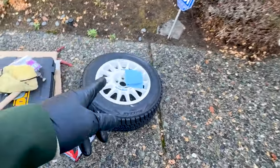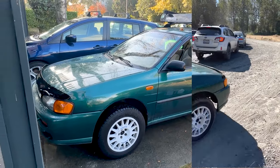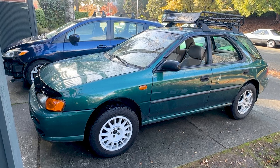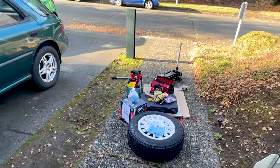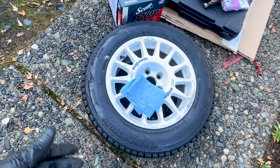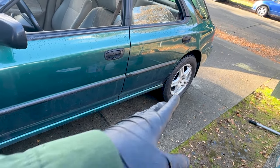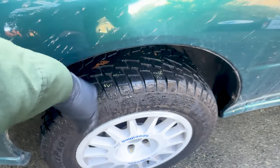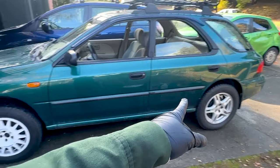The first thing is I went out and got a fresh winter tire. The reason I'm running winter tires is we're going into the colder season, but I primarily use this car for rallycross. My friends and I participate in rallycross events and we have a winter rally series coming up hosted by the Northwest Rally Association. In the stock class, you cannot run any gravel or rally tire, so the best alternative is to run winters. Typically if you have a flat on a Subaru you want to replace all four corners, but I'm able to get away with one new tire because the others measured within about 2/32nds of an inch — close enough that it won't damage the center diff.